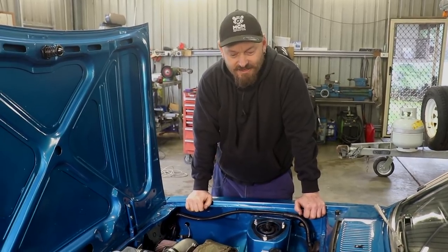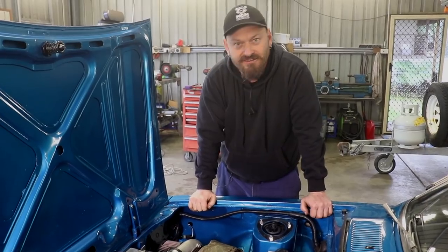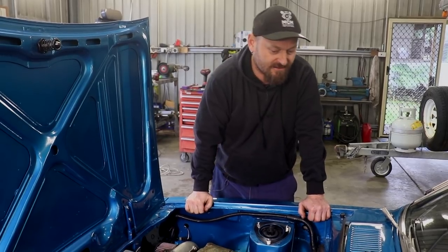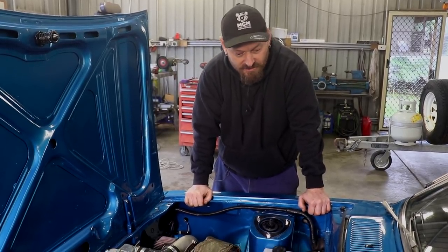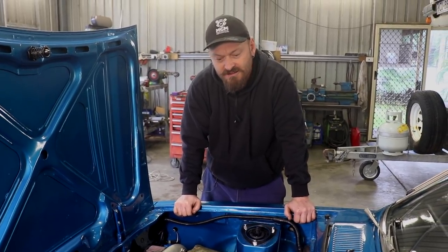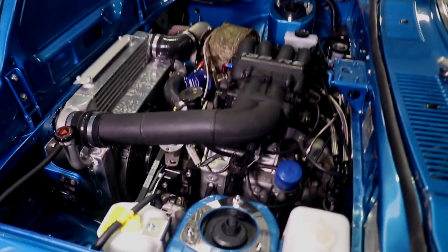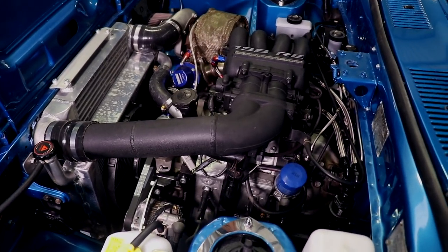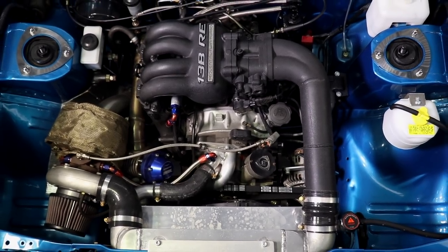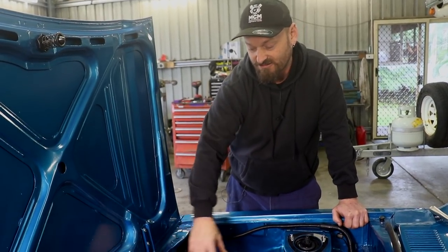This is a 13B Cosmo engine. It's very similar to a series 6 RX7 engine but it has slightly larger ports. They were only available in automatic but you can modify the rear housing to bolt them up to a manual. It's got a series 5 turbo box on it, which is pretty standard for one of these. Luke fitted the engine himself. The engine and box were in the car when it came to me, and he just bought a pile of parts and showed me pictures of some other cars that have been built — and as you can see, this is a bit different.